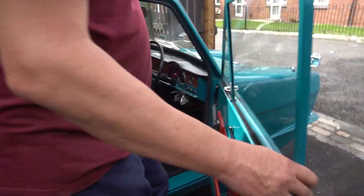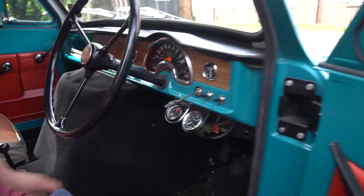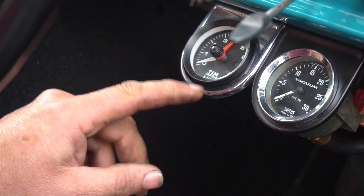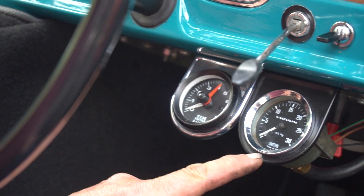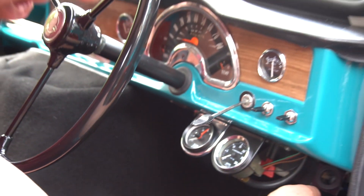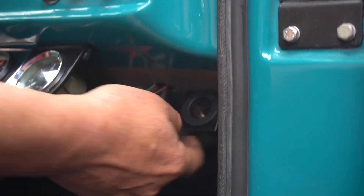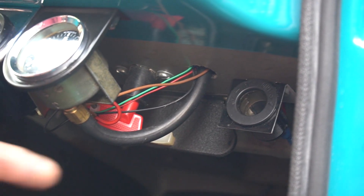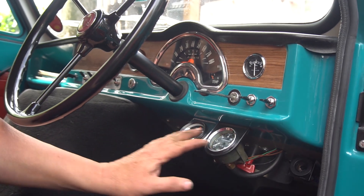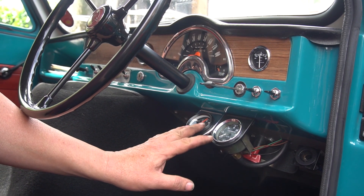Let's go inside the car. A few minor updates here. I've added two gauges — a little rev counter and a vacuum gauge. I'm going to put them in a different housing because I don't like how that is. The vacuum gauge is really useful when you're cruising along. I've moved my cigarette lighter — it was facing down before, and the schoolboy error is that when you're driving along it wobbles loose. I didn't want to cut any of this dashboard up to fit these. All these can be removed and go back to original if I want to, or if anybody else wanted to in the future.